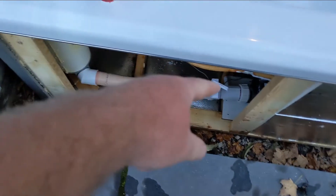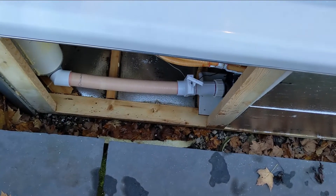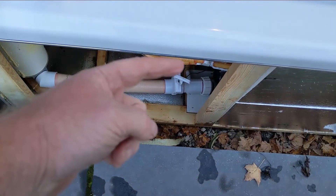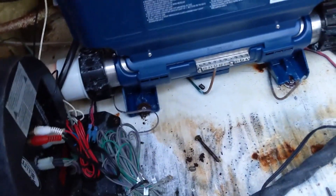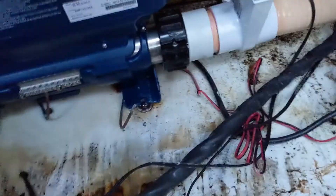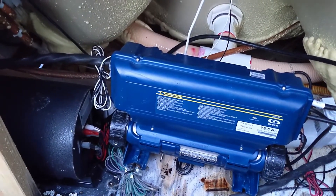It's small enough that it would just go here — normally it's in front of that pump and can't get past that. But I'm going to check the element anyway, because sometimes they get hung up on the element. That's if the pack is before the pump and the pump is pulling water through the element. This one here, it's after — there's no way it can get in there. You never know, that's why you check anyway. Normally it's right in the center there. There's nothing there. I doubt it but you just can't rule everything out. I can't find that flap so I have to rule that out — it might have been taken out previously.